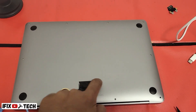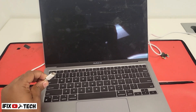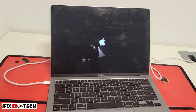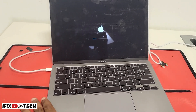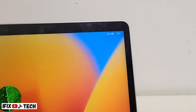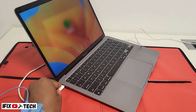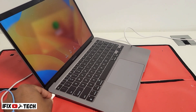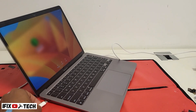For now we are not going to reinstall the P5 screws. Now is the moment of truth — we are going to connect the USB-C cable and if everything is fine we should hear the charging chime. As you can see, we already have that charging signal. Now let's test each of the ports. You can rotate the USB-C cable 180 degrees, then do the same with the other ports — this way we ensure that they are all working correctly.